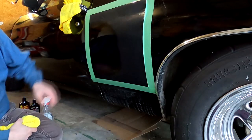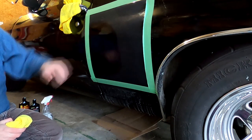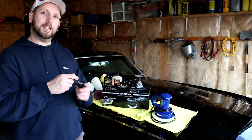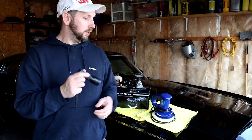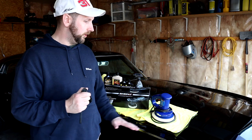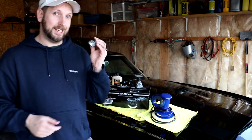Now let's talk about some of the mistakes that I made. Number one, when I did my test spot, which you would see from the previous video, I was looking at the results under garage lighting. That's not good enough. You need to use at least a flashlight. And let me tell you, this can be your best friend because you will see any of the swirls or imperfections that are going on in your paint correction that you will not see under just garage light bulbs. It's just not going to happen. So this is one of your best friends when doing paint correction.